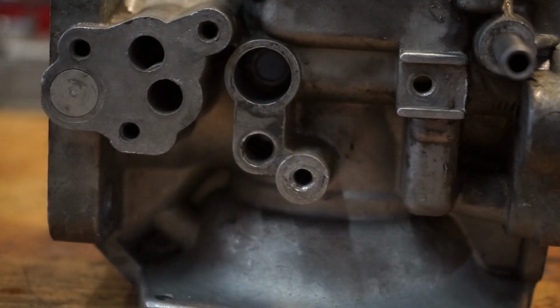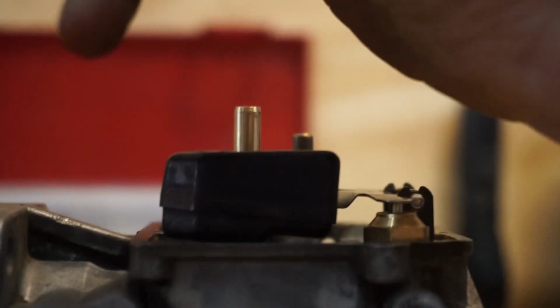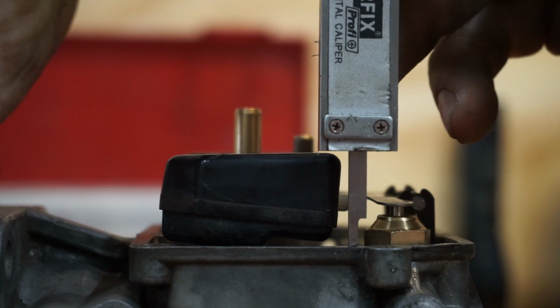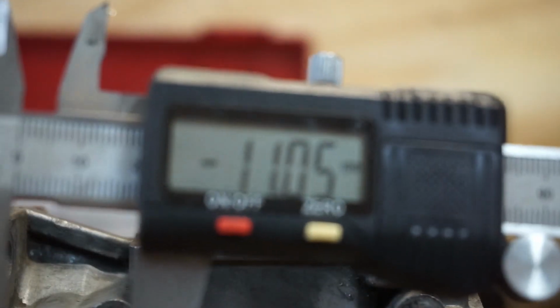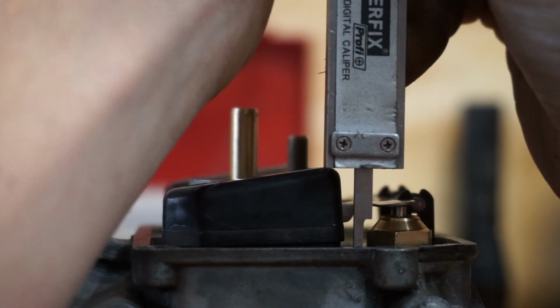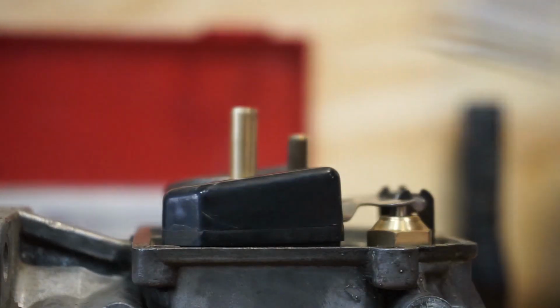So how you're doing that is you're taking your camera, or well, I'm taking my camera, and I'm just gonna walk you through it. So you'll take this thing, and then you can shove it on the back, and just make sure this corner right there is above the float, so like that. And then we are now at 11, so that's not good. Then you take this lip, you can bend it, just very carefully bend it. Always be careful with your calipers. All right, okay. Look, we need to be between 15 and 17, and we are exactly at 16.28.